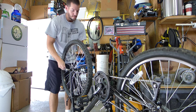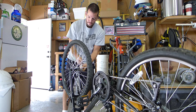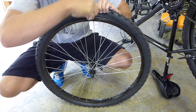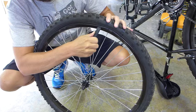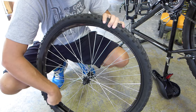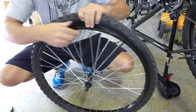You're going to take and loosen the wheel off the rim. Now using the tools in our kit, we're going to use one of our tire levers. Get in here like this, pull one side of the tire out of the rim, and just slide it around. Once you get that far, you should be able to peel the rest of the tire and tube off the rim carefully.